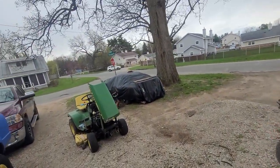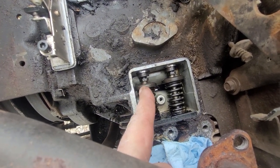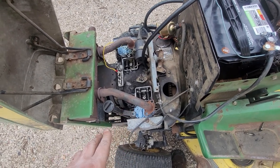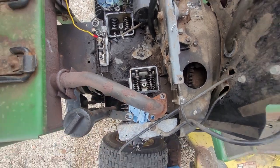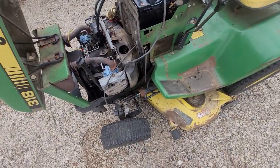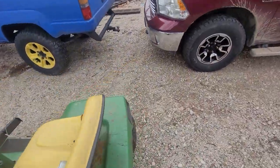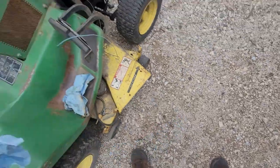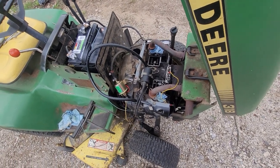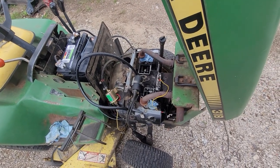With the way it was spewing gas back out of the carb, I kind of wondered if it had a bunch of blow-by. That lower part is a nut and that is also a nut, so you hold the upper with a 5/8 and you turn the lower with a 7/16 until you get the clearance between the stem and the lifter. This side had zero clearance, so I'm sure the other side does too. All I did was spin the flywheel with a zip tie in the plug hole until I couldn't pull the zip tie out — then I knew I was at top dead center. I checked my clearances and I'll do the same on the other side. I expect it to run a lot better. For all I know, that fuel pump might even work — we'll see.